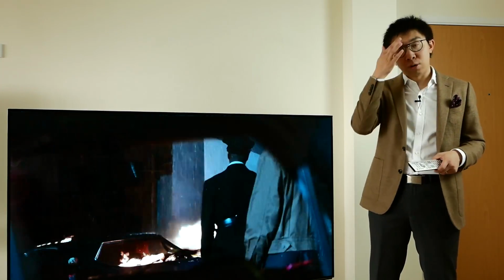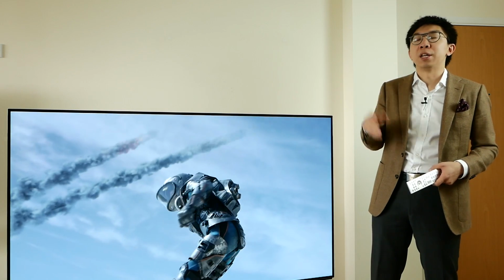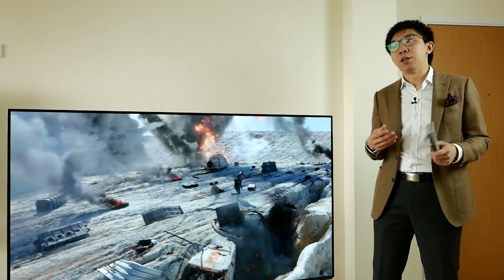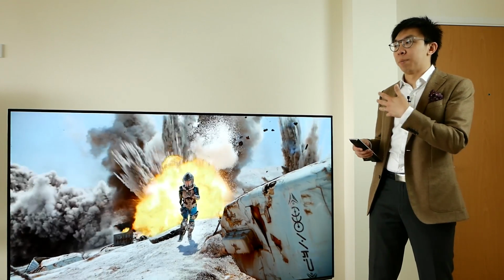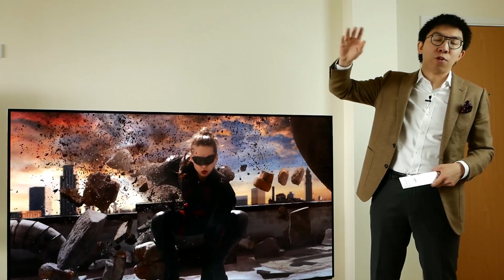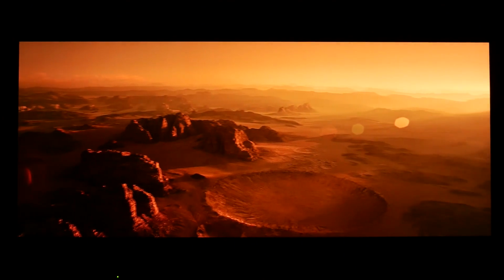because this is the same approach that is used by Samsung and also LG on their B7 OLED. So on the Samsung SUHD and QLED television, they try to maintain as much detail. In fact, I think they're maintaining the full detail up to 4000 nits, and the same applies to the LG B7 as well. But in doing so, they invariably introduce some posterization in what should be smooth gradients. But on the Panasonic EZ1002, I think it is discarding some very tiny detail at the very high end near to 4000 nits. But in terms of the smoothness and the suppression of posterization, I think it does an outstanding job when it comes to HDR10 tone mapping.